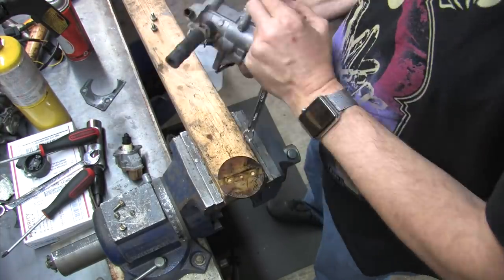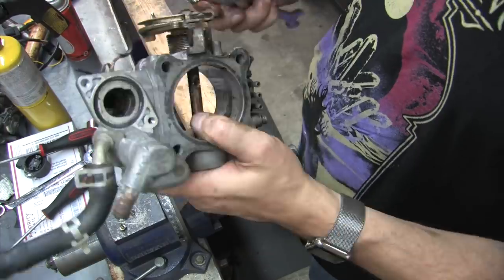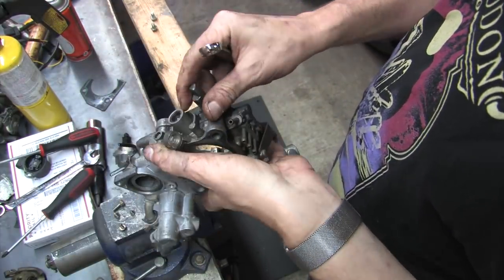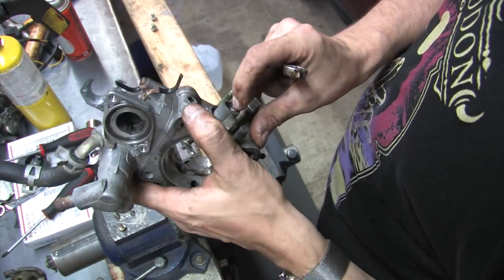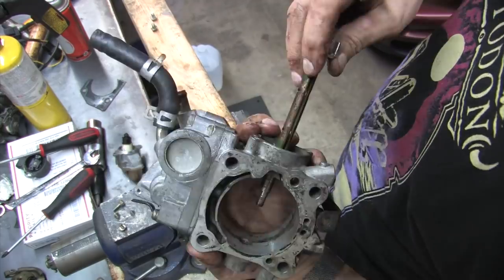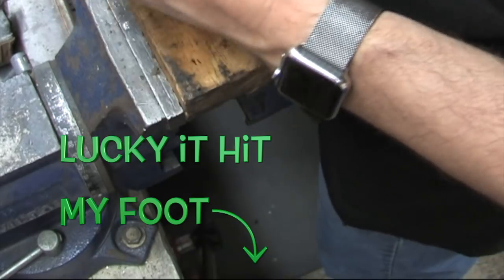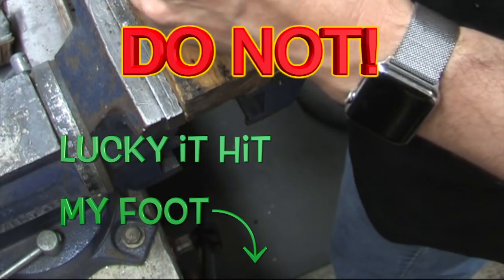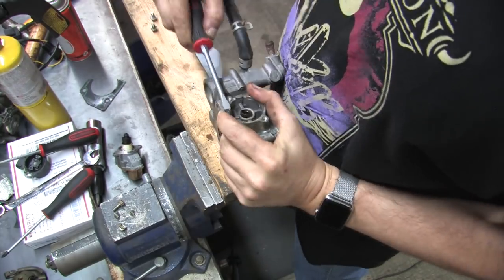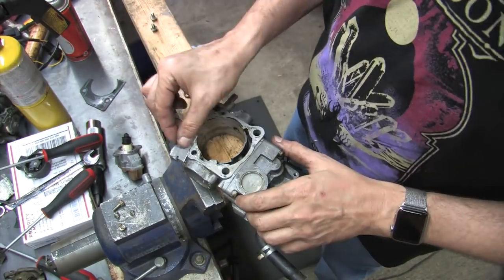The linkage that engages the throttle position sensor is huge, but to most of you looking at this, it's normal. This is what yours looks like. To me, it looks like this thing's never been apart. It still has the mil-spec seals installed, and none of the fasteners have any tool prints on them indicating that anybody's been in here. I popped both of the seals out with a screwdriver. Oops. Yeah, don't do that. And gave it the razor blade, wire brush, and a rag treatment. I have to do something different this time, so I'll forego the carb cleaner.